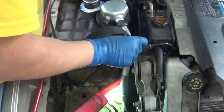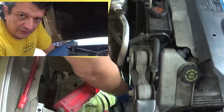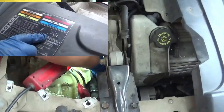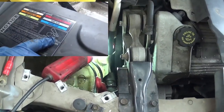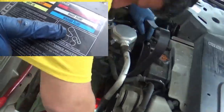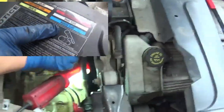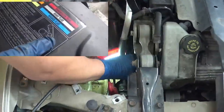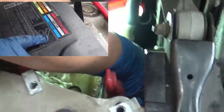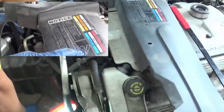So this crankshaft to the air conditioner. What I prefer doing, I like to go down and loop it around right here. This is the crankshaft. I like to start at the furthest point away. Crankshaft, AC compressor. Get those two at the bottom. And then come back around the tensioner right there, then to the power steering pump, alternator here. And then the very last one I'm going to leave is the idler pulley, which allows me to slip it on right there.